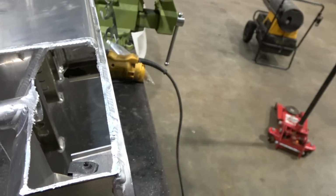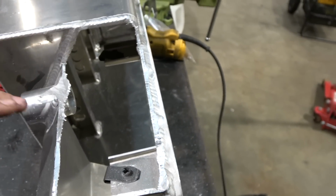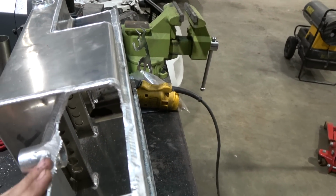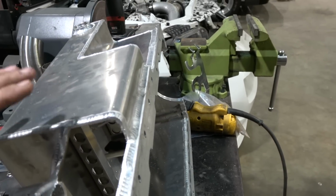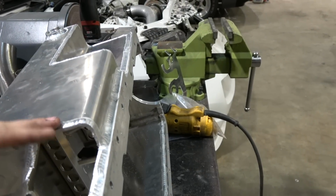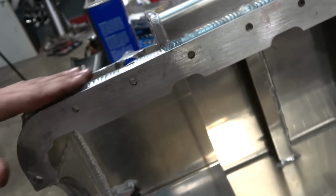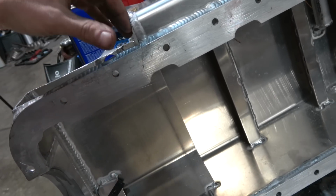and this is going to be a pretty substantial increase. I really tried to go as close to this as I can, so I kind of taper cut it right here, because if we're going to cut this, we're going to try to get the maximum amount of material to use. And if you notice too, I cut along the weld, and I left some of the weld because, in my opinion, it's easier to weld to an existing weld than to weld to sheet metal. A little bit more material and everything. So I'm gonna come in here, clean this edge up, make it nice and flat to where when we put a piece of material over here, it's gonna be a nice square box, and then we have this to box in. So yep, not gonna be too bad.